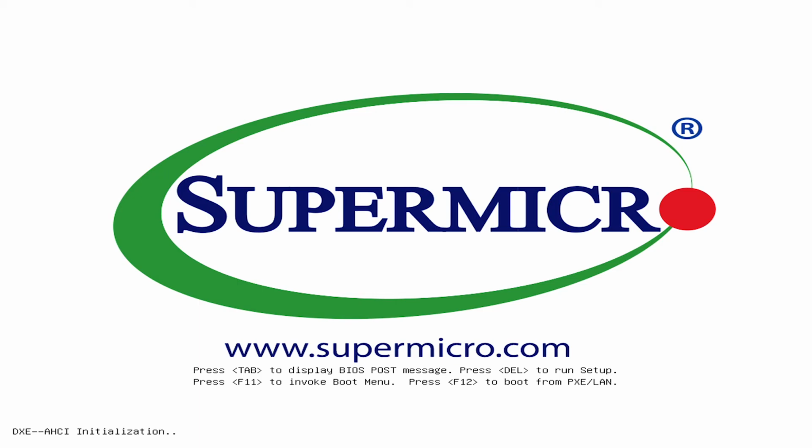So that means that it's running 5.2 AVX and non-AVX. And that's something I'm going to show you here next. That's probably one of the last things we'll cover in the BIOS, is if you're going to tune something like this in, keep in mind that you can follow our basic setup. I would recommend starting with a 1.35 V-core setting, just because that will help support far more chips. And you can always drop it by 5 to 10 millivolts at a time.